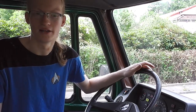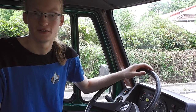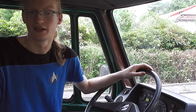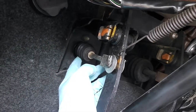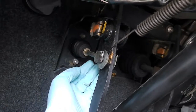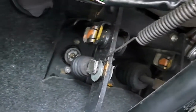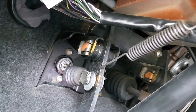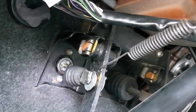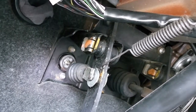So I guess it has something to do with the higher vibration levels while you're going on the highway. I'm not 100% sure, but I found out that the master cylinder is leaking. I don't know if that's the only thing that is leaking, but I will show how to change that. So to see if your master cylinder is leaking, just have a look by the clutch pedal where the master cylinder is mounted into the firewall. If you can see some brake fluid or some dirt at this rubber boot, that's quite an evident sign that it's leaking. You can just pull this whole boot back and have a look at the cylinder itself. And if I shine a light in there, you might be able to see that it's all wet with brake fluid. It's not a lot yet, so it's not that bad. The clutch does still work most times. But if you have some problems with the clutch and you see that, it's quite an evident sign that the master cylinder is going bad.